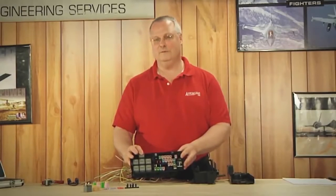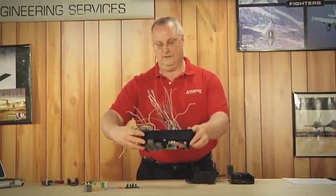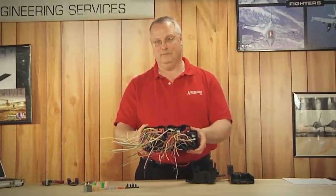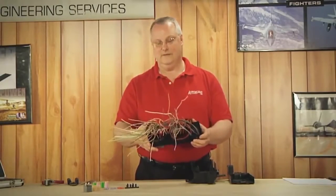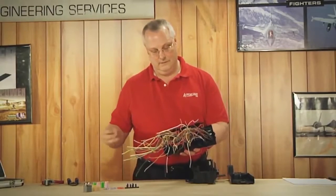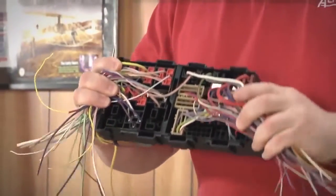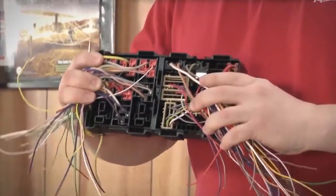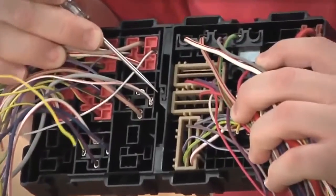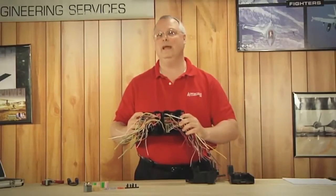Let's look at a few shortcuts while we have this fuse box completely assembled. Swapping each wire in and out trying to remember pin position looks pretty ugly — but check this out. This is very common for a lot of fuse boxes. You separate the wires and take a closer look, and you'll see that this piece has two halves with a locking feature. You can separate these two pieces and only replace the half that's damaged.